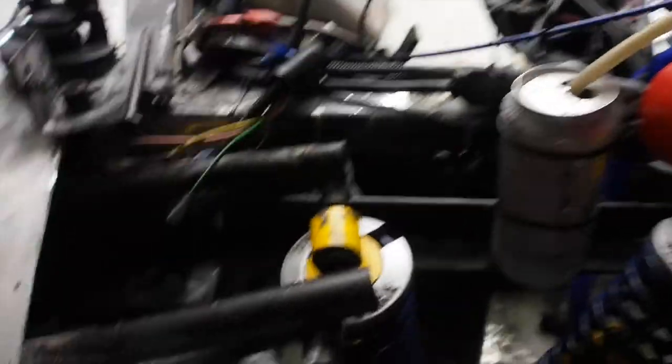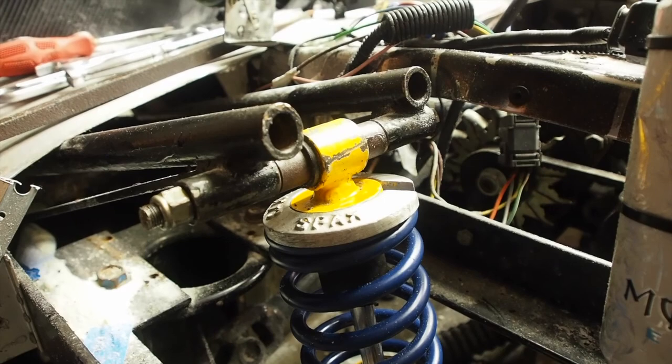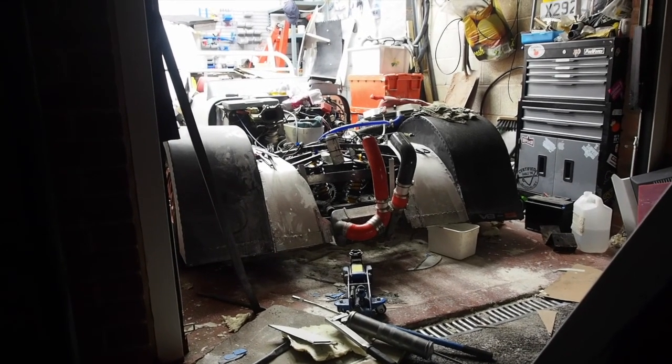It's Wednesday night and I've got my spring compressors now so I'm going to get the shocks properly mounted. The spring compressor was absolutely no good at all. What I actually needed to do was jack the car up. I've got the track down there which means the wheel sits like that and I'm able to get the top arm up - nice and free to move - which means I can get the bolts in, quick and easy. That is one side mounted up. Front suspension is all back on and you can see the ride height is sitting at a much more realistic road-going ride height now.